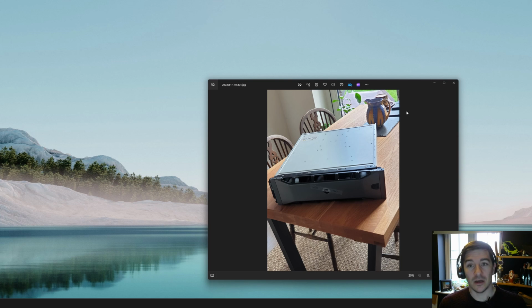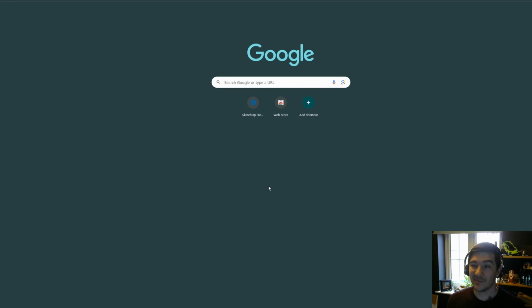We ended up replacing basically all of the internals. What I needed to do was strip out the entirety of this Dell server and remove anything proprietary, because it needed to house consumer parts. I wanted to be able to put in my motherboard of choice, my power supply, etc. As it's a 3U, I was limited in height to a 120mm fan. It actually happens to be perfect because the internal measurement is 124mm.